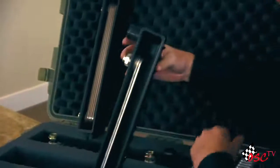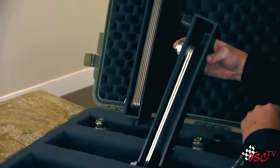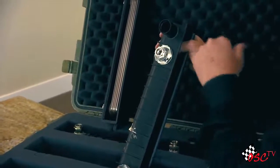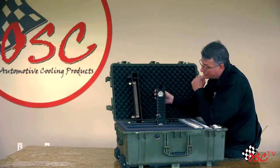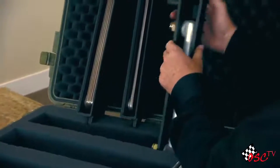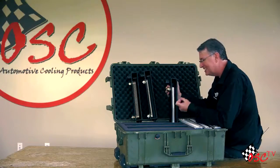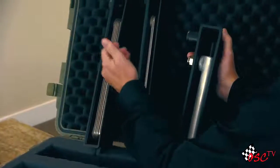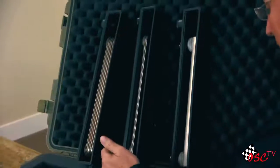On the BP brand it's not a four plate, not a three plate — it's a two plate cooler, so it has half the cooling of the OE original unit. You'll notice they did use a GM paddle nut on the outside but they put a washer underneath it, they don't mark it, so if it's torqued in position or not you just have to assume everything's done correctly. On the 800 brand, they went to an aluminum concentric cooler. Depending on the size, the aluminum concentric cooler is equivalent to about one to one and a half plates of stainless steel — so it's even less. Original four plate, two plate, one plate.